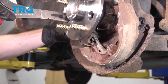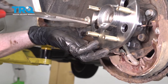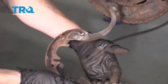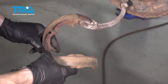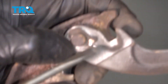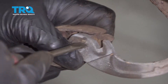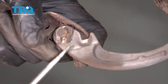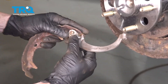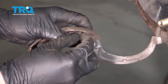Let's do the other side here. I'm going to try to find that pin from the backside, hold it, give this a little twist, and release the pressure on that spring. Get all this out of here. Now we can swing this down and pull that right out of there. The next thing we're going to do is separate these ears — sometimes they're very close together. Just use a screwdriver to spread it a little bit, then slide it out and over this pin. Give this a little twist — you're also going to find another washer on there. Try to draw this shoe out of here.